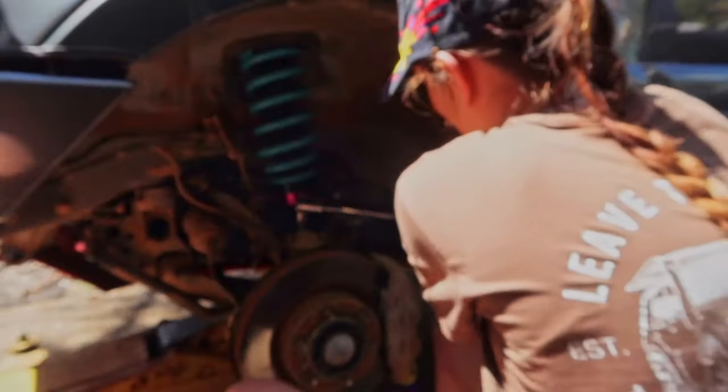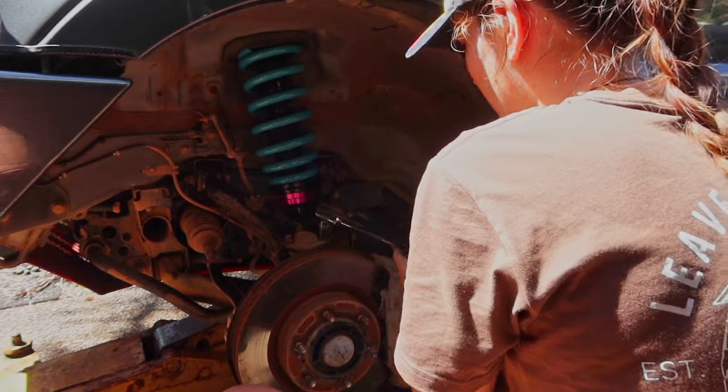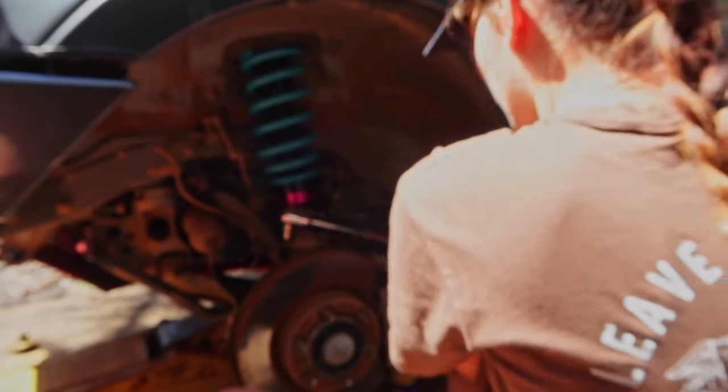And then we put on those three bolts that we did on the very first step, and then I used a torque wrench to set them to 60. That's what I just found on an online Pajero forum, but I could be wrong. The bolts are a lot longer than the standard.